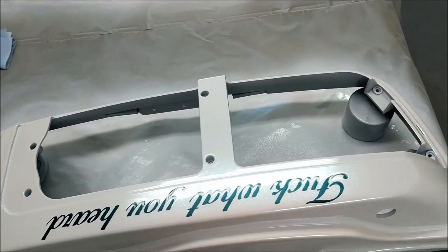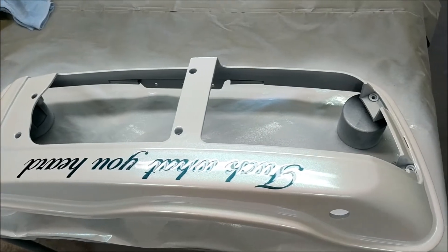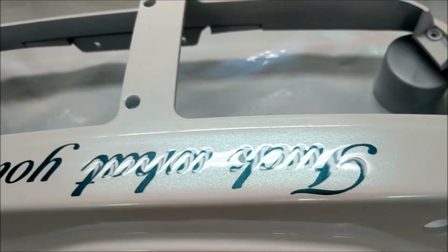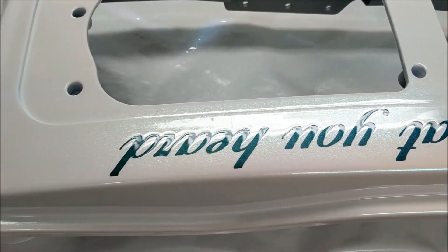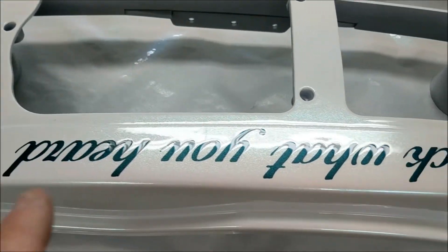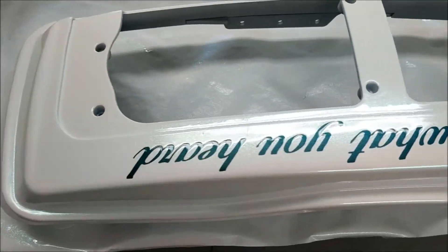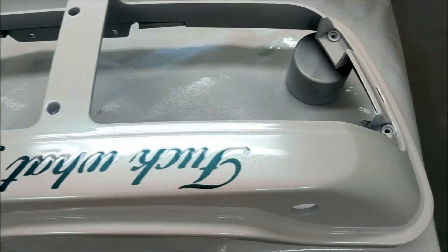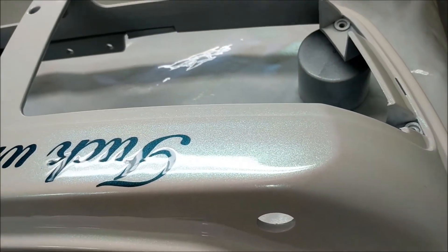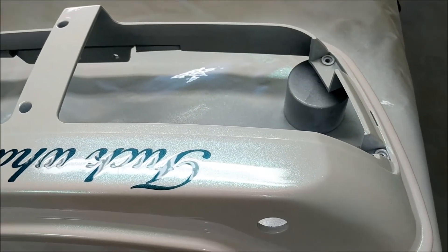This is probably gonna be the last video for tonight until you see these on the bags. Look how smooth that clear is - and there's only two coats of clear from that Yurkim high solids. You can see I've got a little bit of indentation between the graphics and the clear, so I gotta bury a lot of clear up here to fill that in. This is going to be a long process - letting this stuff cure really good a day or two before I come back and lay some more clear.